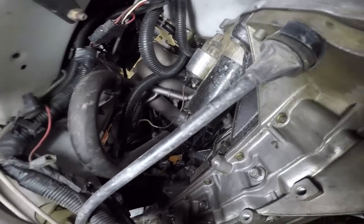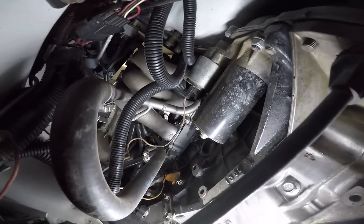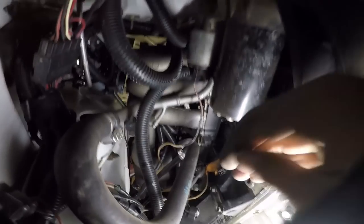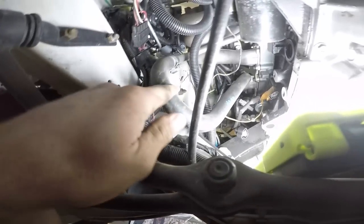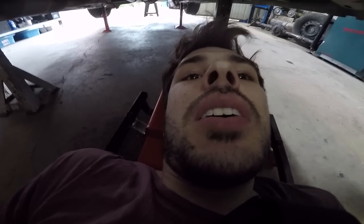Another thing that was challenging was the heater lines. So that is this custom. I used a combination of E series and BA heater lines and cut them up, and that's what this tube is here. It runs around behind the head and tucks in really tight. It is meant to be up on the heater core, but my heater core sort of split and was leaking, so that's why I've blocked it off, and it's just got a bit of tube looping it. So that was a pretty tricky job, but it's up there at least.